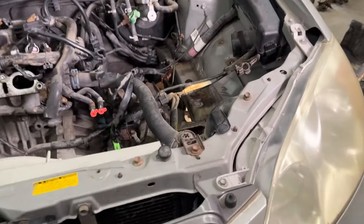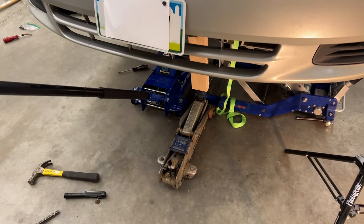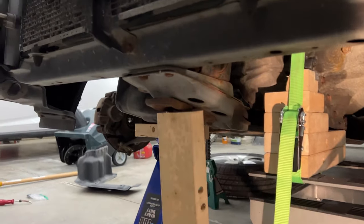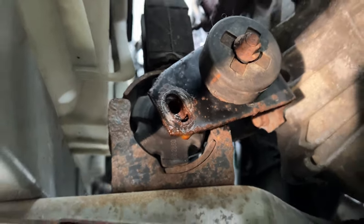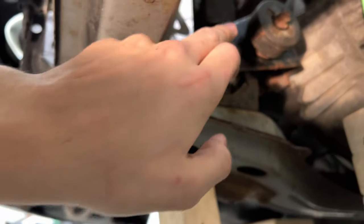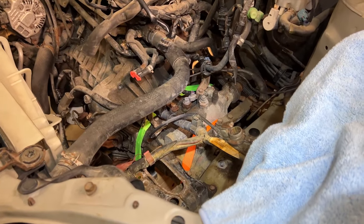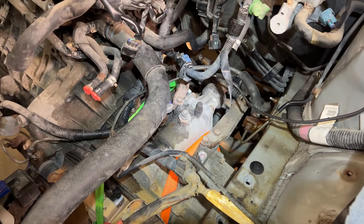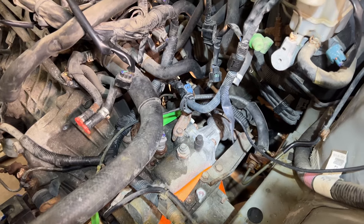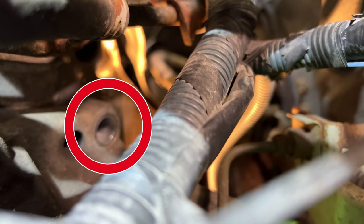The car is up higher now. I got the starter pulled out — there's a 14mm bolt there and one down below, and I had to mallet it out. I made a jig to lift the transmission when I need to separate it, and I'll use a small bottle jack to control the movement and another jack to support the engine. Getting the lower motor mount bolt out required a third jack to support the subframe so the bolt could come out freely — without that jack, the flex in the subframe was getting the bolt stuck.